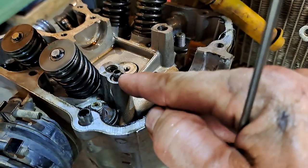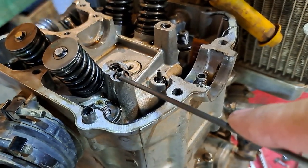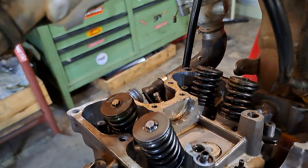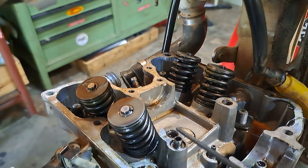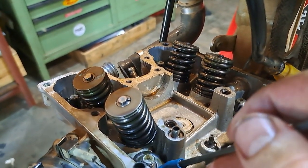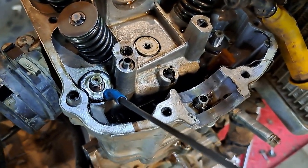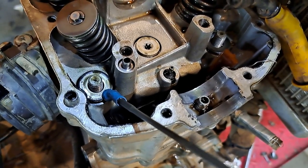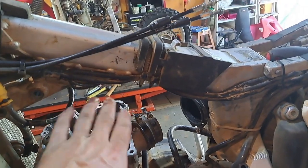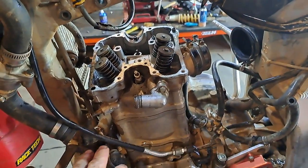Also this is loose, so if you've got your magnet it'll come out - careful, it's missing its O-ring, but thankfully it's over in the valve cover so we're okay. Bear in mind there needs to be an O-ring there. There are washers here and you don't want to drop them down into the rest of the engine. With the valve cover out, I'm now going to gently start tapping around carefully on the head to try to loosen it up from the gasket.